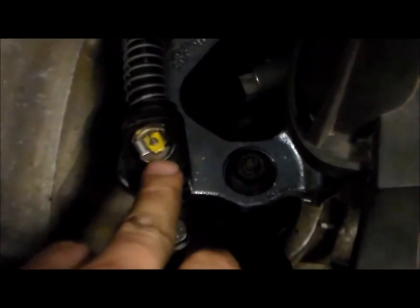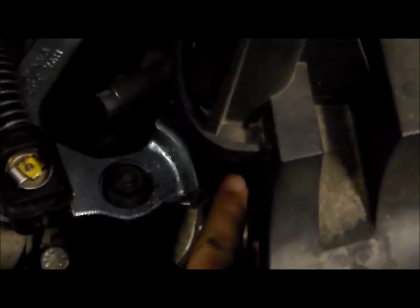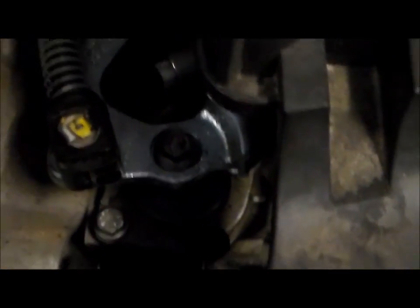I got the HPA short throw shifter installed. I just popped this back over the pin, installed this little clip which slid back on, and there's another clip here that you had to pop in after pulling the crank all the way through to align inside the groove. Put the nut on — do not over-torque this, because it will break and it will cost you about $600 to change the whole housing. So be very careful. I'm going to hop in the car and measure the travel.